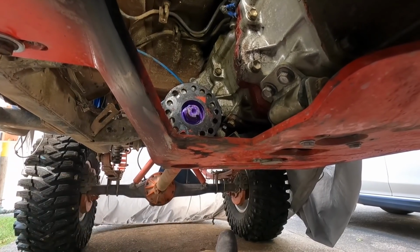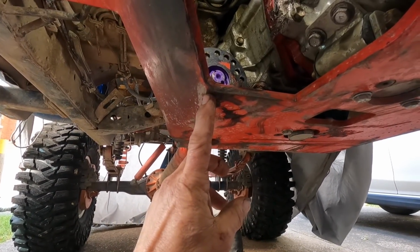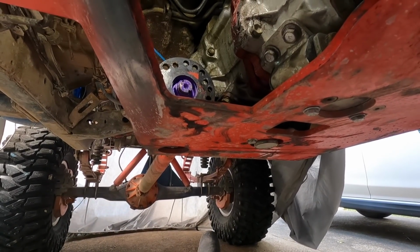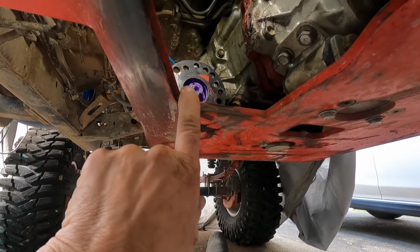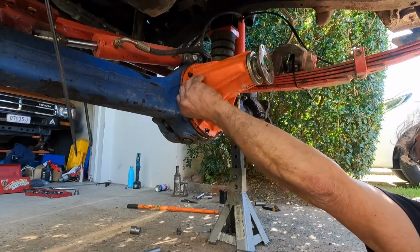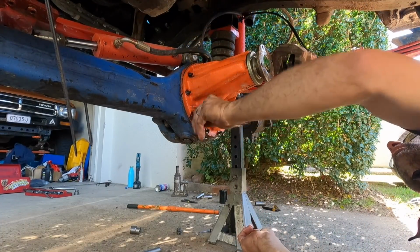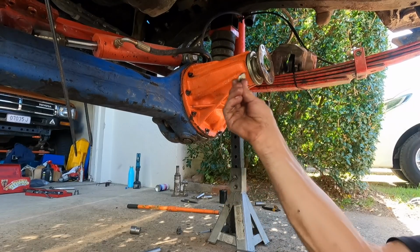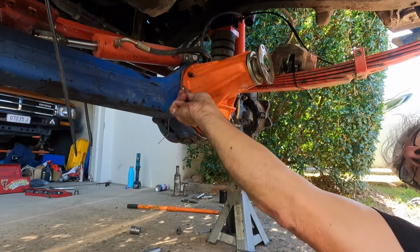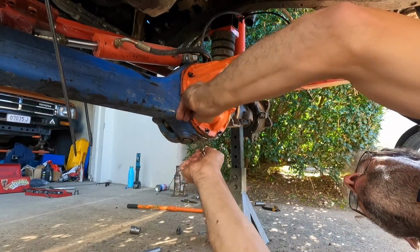Now organising all this over the phone with drawings, and them not having the truck, I'm hoping I don't have to take a little bit of this out, but we have to play it by ear. It's an 80 series uni at that end, whereas before we had the big double cardan, so it should be okay. With that front center, Brian's definitely not going to have the clearance to drill new holes, so a multi-fit flange it will be. So hopefully we can find one pretty quickly, because there are 29 splines on the Nitro pinion gear, and not the 27 that your standard Hilux would run.